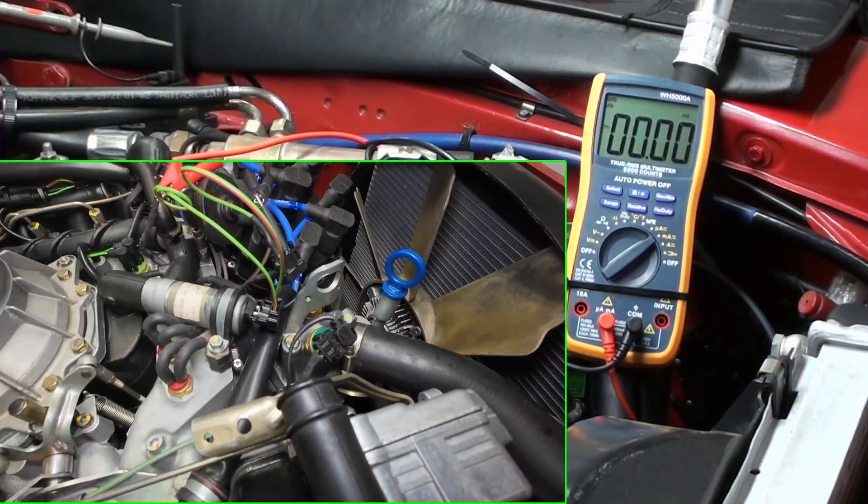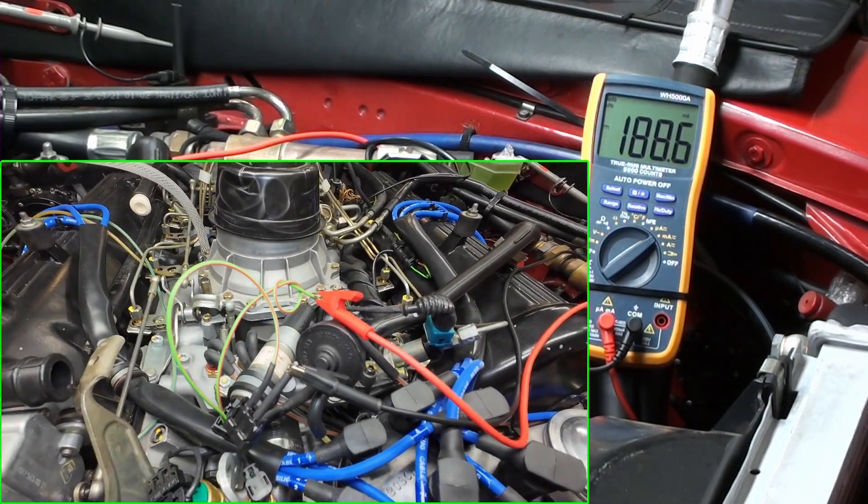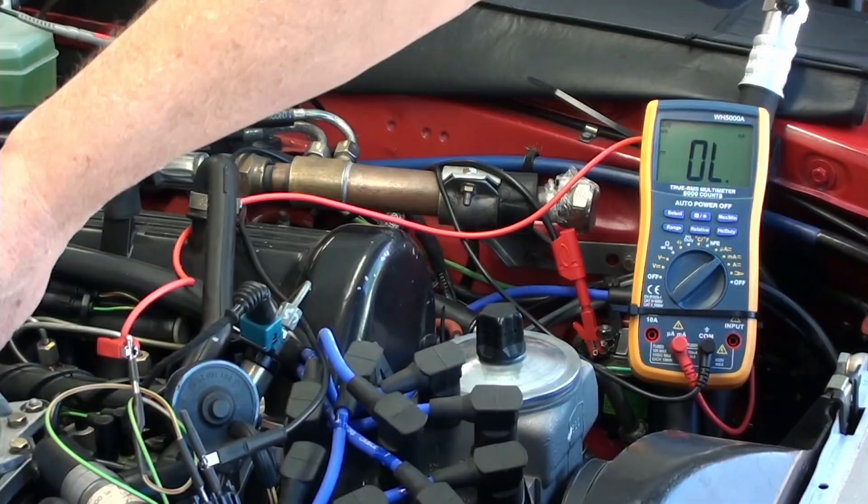You guys are probably saying, Tony, there's one test you forgot to do. I didn't really forget that test — the test you're referring to is when I tested milliamps on the ISCV, the idle speed control valve. I got about 188.4 milliamps when I tested that with the ignition in the on position. But I'm going to put a clip here showing why I'm not going to perform that test. If you look at my multimeter, it says OL — that's overload. My multimeter, if you're going to measure anything over 600 milliamps, you have to use the other plug for 10 amps. So I overloaded it and actually blew the fuse on my multimeter for the milliamps range. Then I switched it over to the 10-amp side of the plug, and I blew that too — or it was already blown. I'm not sure. And I don't want to take chances with my oscilloscope because I don't want to blow anything up.